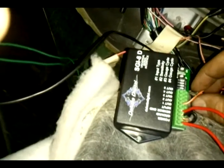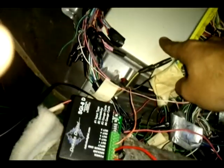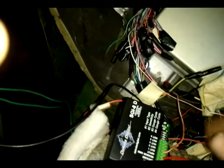If you have a normal tachometer and don't have an aftermarket tach, the second output goes to your tachometer. Over here, the input — if it comes from your computer, from your ECM module — goes straight to the input. That's basically it.